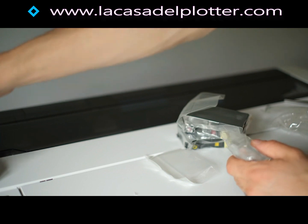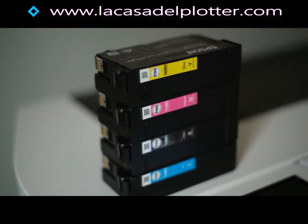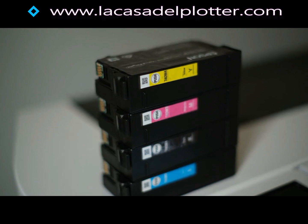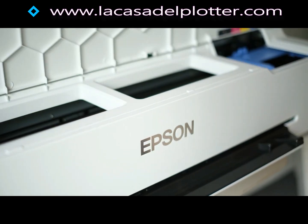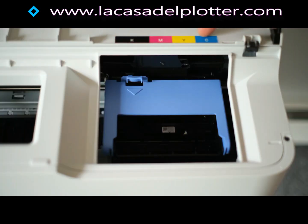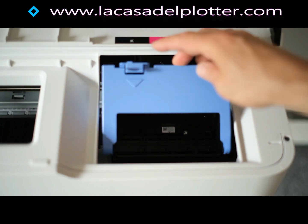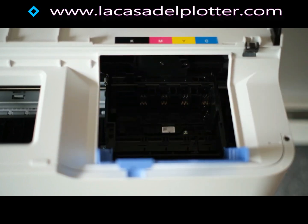The T3170 has 4 inks, and it comes with a starter set of cyan, black, magenta, and yellow. Go ahead and open the front cover. The diagram above the printhead shows us which color goes in which slot. First, lift up this blue cover by pulling the tab towards you and up.